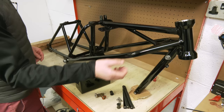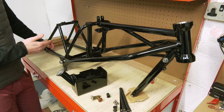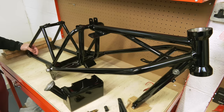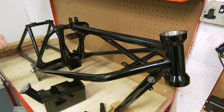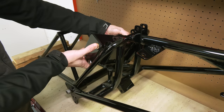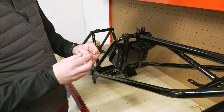What was interesting about these earlier Vincents was that they had this huge wrap-around section — the engine sits in the heart of the frame and these frame tubes come round it like that. This was 91 years old replicating or setting the design standard of bikes we were seeing in the 70s, 80s, and even the 90s — your more modern bikes with a box beam section wrapping round the engine. He was doing this in 1931. All taper roller bearings throughout — the steering head and the wheel spindles. Starting to put this back together now: the down tube's on, head steady's on, rear frame's in. We're going to fit the oil tank next — it goes on with these straps and rubber mounts in the frame round the back.